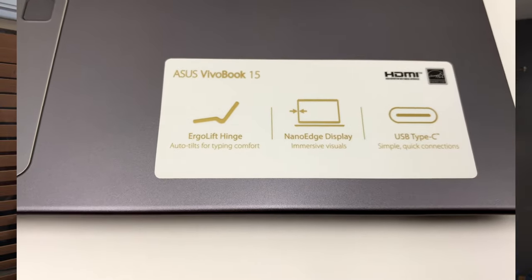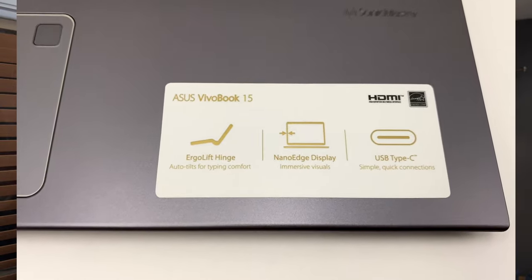In terms of upgrading the RAM on this thing, that's easy enough to do. It comes with 4GB of RAM standard, and if you're willing to take off the bottom of the laptop, you can pop in another 8GB stick in there and give yourself a little bit of extra RAM breathing room if necessary. For most people buying this computer, I'm not sure that you're going to need to do that.